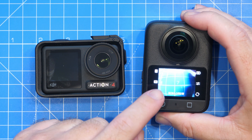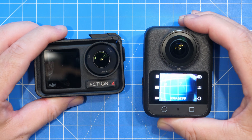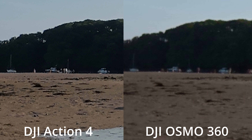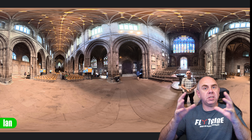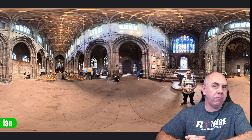It's also worth noting that even if the camera has a feature like the Osmo 360's single lens mode, it may try and behave more like a traditional action camera, but you are still putting the same field of view through the same lens to the same sensor and as a result you have the same compromises. Just demonstrating the single lens mode on the Osmo 360 on the right compared to the Action 4 on the left - I've zoomed these images in to give you the same field of view and you can see there is a lot more detail in the left-hand image from the Action 4 than in the Osmo 360, even though they are technically recording at the same resolution. Even though these cameras may be using high pixel density sensors, the fundamentals remain that you are trying to cram in a very large field of view into a smaller sensor space, and as a result when you crop that into a normal usable image you see a reduction in resolution.